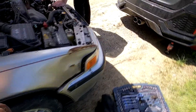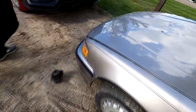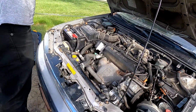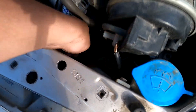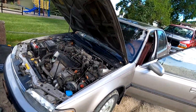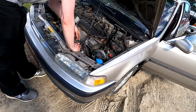So what are we doing here, Matt? We're going to put the alternator on properly. Then we'll take it for its maiden voyage and go scale it to see how heavy it is. But we had to run out because the alternator isn't working — when an alternator becomes a magnet, it's a bad alternator. Watch: Matt puts the negative back on and the tool sticks to it, then undoes it and it falls off. I've never seen that happen before. We picked up another alternator — that's probably why the battery light has been on.